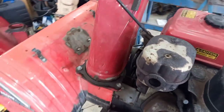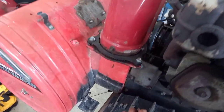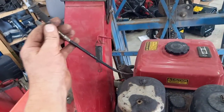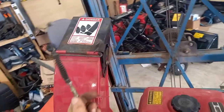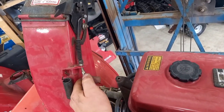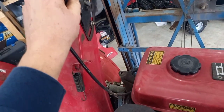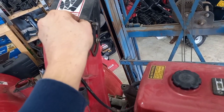To buy myself a little more room to get at the top bolt, I'm going to remove this plate here — this protective guard. I decided to remove the chute as well; it's pretty simple. There's a tension spring here for the return on the chute deflector, and there's the cable, which just slides in like that. So you loosen this 10 millimeter nut, slide it down to the cable, slide it out, and then bend the barrel bolt and it slides out of the holder here.